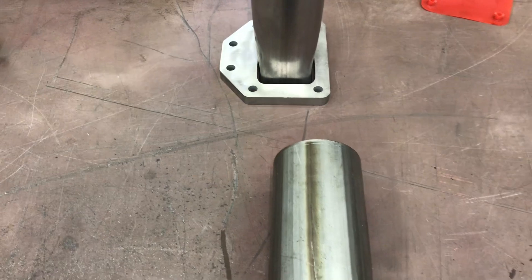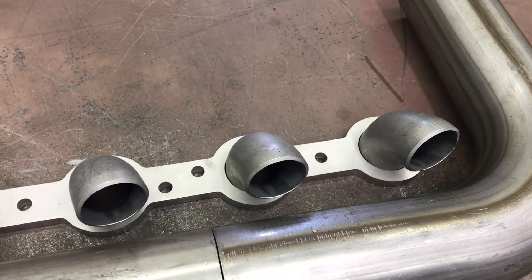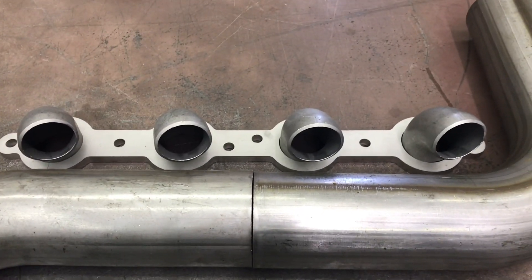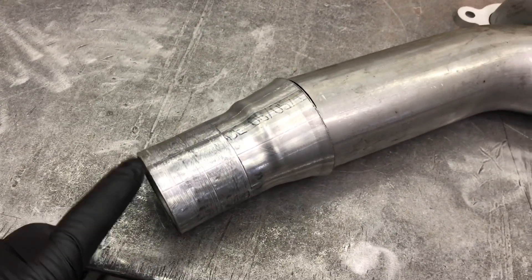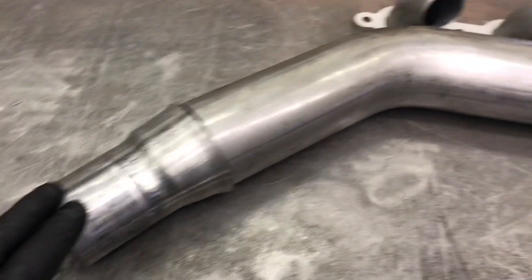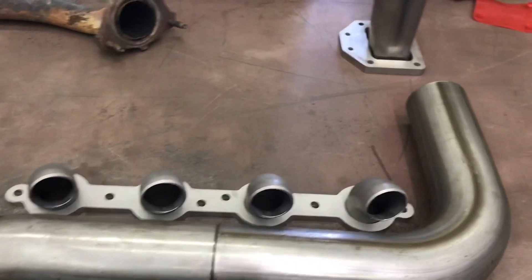It'll be lighter, hopefully as strong - you're only on six 8mm bolts. Like the twin turbos I showed you yesterday, I'll probably run a brace between the turbos and/or brace to the engine. It has solid mounts so I could brace anywhere without concern. I'll step it down to two-and-a-half inch and use one of those stainless shorty headers on the driver's side for the crossover, putting my wastegate somewhere around there. That's a project we're going to do in the upcoming days.